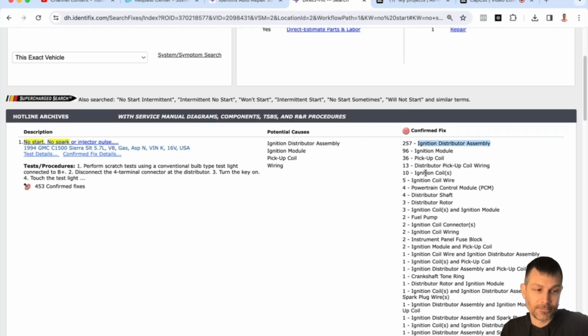I went and bought a coil because I did the first little initial no-spark test, unplugged it, and I didn't see any spark anywhere. So that's when I had it towed, because I didn't know what else to do within a public parking lot. I had it towed up to Firestone, and he told me a couple of days later after he finished diagnosing, the coil's fine. If not that, it's your ECM. I said, okay.